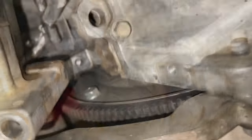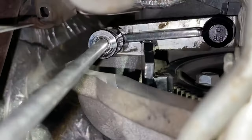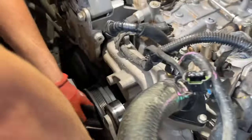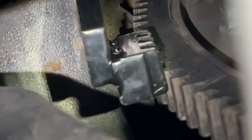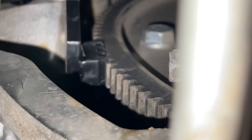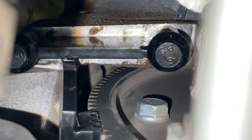...now you can see the flex plate of the vehicle, also known as the flywheel. You can see the teeth that the starter uses. All we're gonna do is put the tool up in here and run the two bolts up in there for the tool. A tip: get these started and then wiggle the crankshaft back and forth with a 24 millimeter socket on the crankshaft to help wiggle it into place. As you start to put it on it may look like the teeth aren't fully meshing — don't be alarmed, as you tighten those bolts down all the way they will mesh completely.